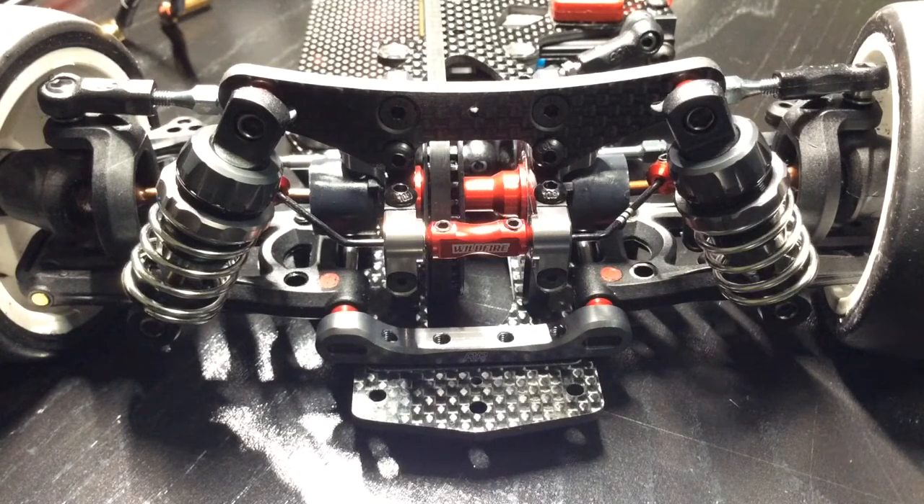The same can be said going the other way: using the silver spring in the third hole gives a ride stiffness value of 0.84. If you were to simply switch out to a pink spring at the second hole, it's 0.85 — there's really very little difference between those spring changes.